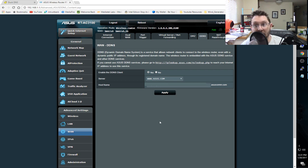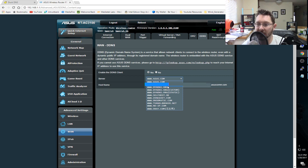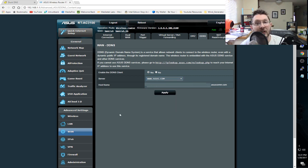Now, the next thing that you have to do, so this is what I was saying, this is complicated. That basically keeps it up to date. See the server section? I've got an entire list. I can click on here, and there's a whole list of different places that can offer that service. In fact, I think I saw one that was even Google. Oh yeah, domains.google.com. I think that one's free, if I remember right. So you just set it up with your router, and your router will constantly keep your IP address up to date, so that new domain will always work.